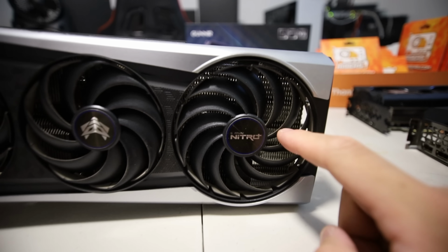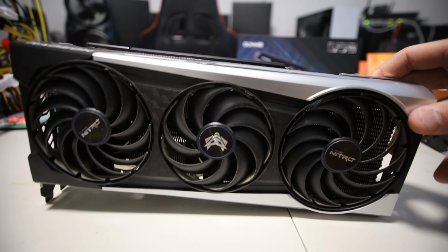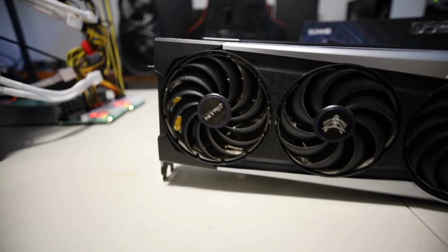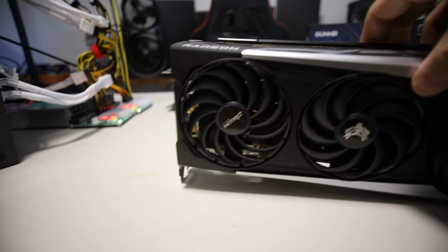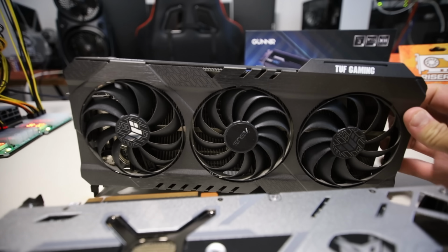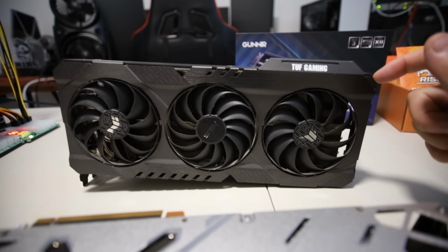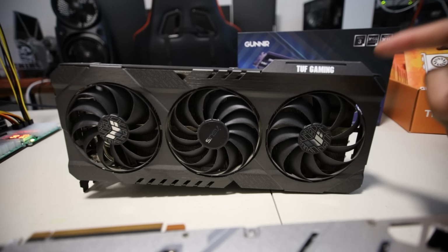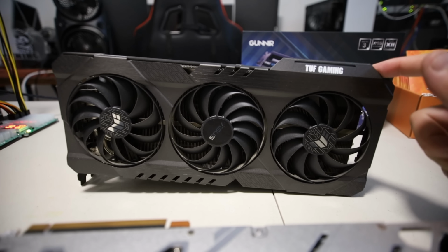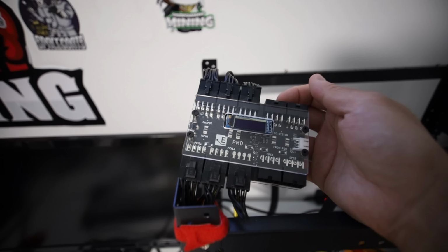In this video, I wanted to test out this RX 6800. This is a non-XT, and this is specifically a Sapphire Nitro Edition 6800. What I want to do in this video is very similar to a video I did recently on the 6700 XT, where we found out the optimization using Hive OS and Team RedMiner and the SoC settings, the overclock settings in Hive OS, that we were able to get about 46 to 47 megahash, but at about 80 to 85 watts. And we did confirm that utilizing an Elmore Labs power measuring device, which was really cool.